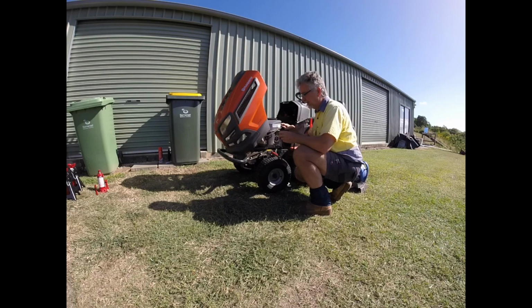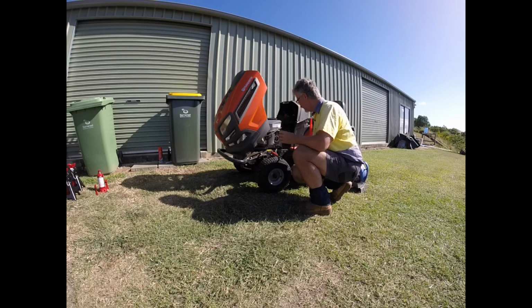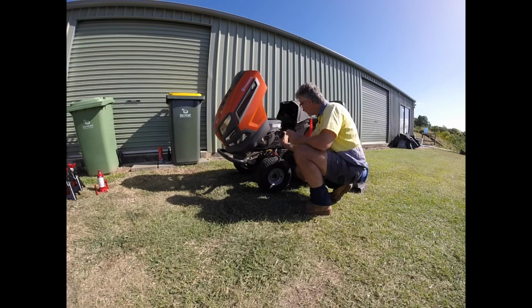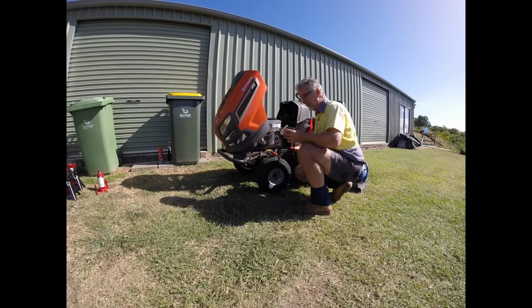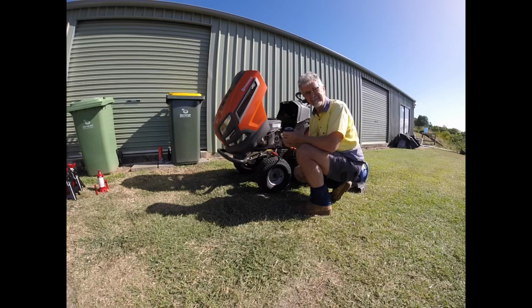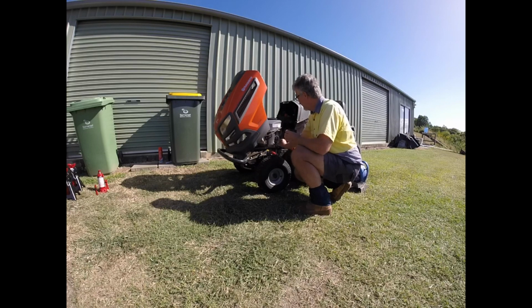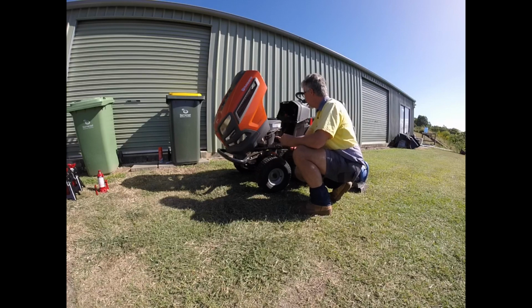Not good for engines to run without oil and things. Now obviously it depends a bit on the scenario that you have. In this case, because we're putting an oil filter in on the side like this, I could technically put half of the oil into this oil filter, but that may not practically work. So I'm just going to put enough in there to give me a head start so that some oil can start pumping through the engine as quickly as possible when we start things up.